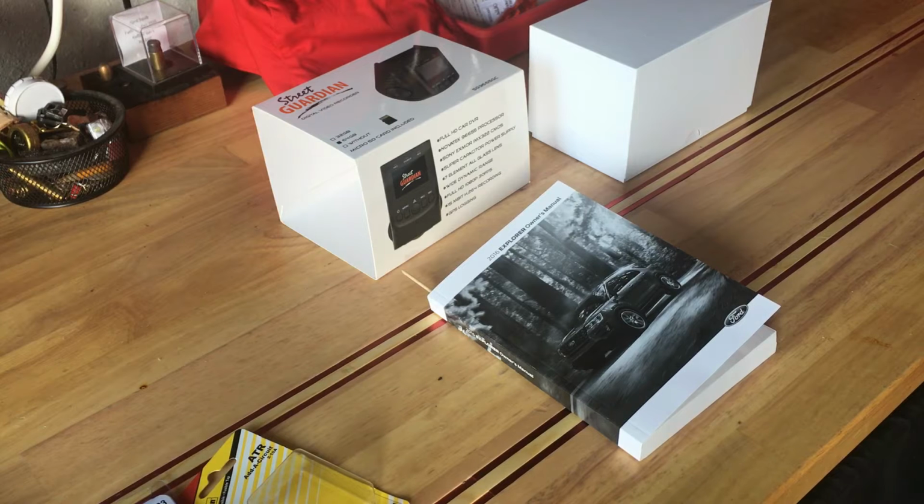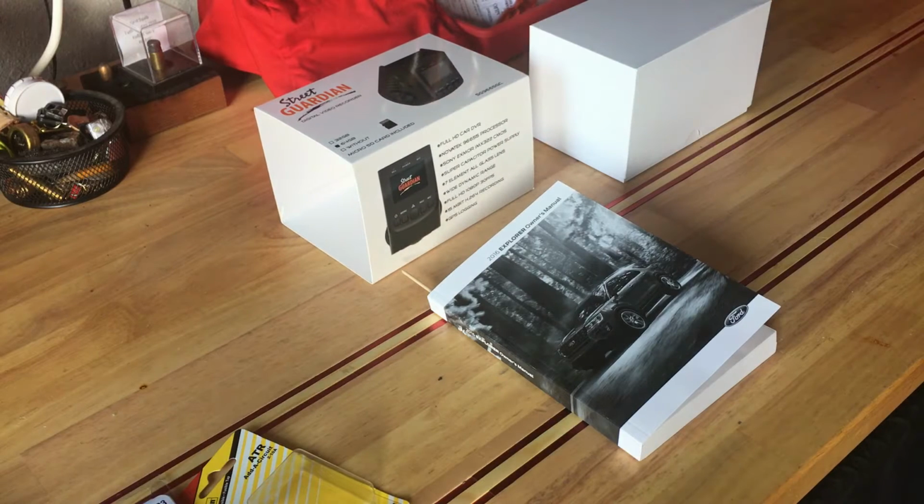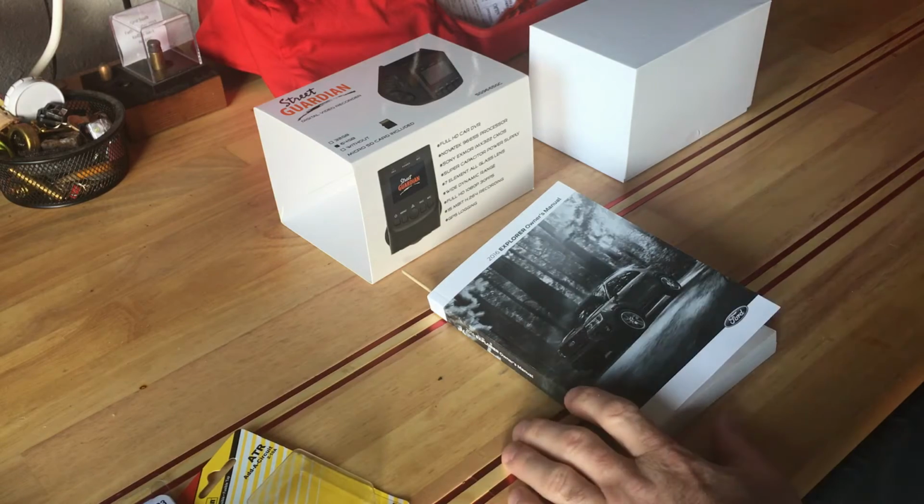We spent more time wiring than we did doing the install, and we did add a tap to the interior fuse box and popped the panel, popped the fuses in, checked connection, ran the wire, adhered the unit to the windshield, and all was good. So we thought we'd have the same ease of luck with a 2016 Explorer.